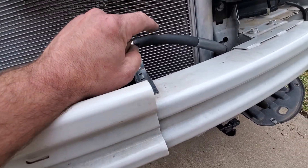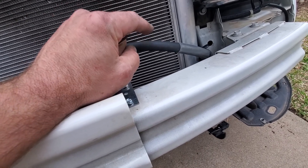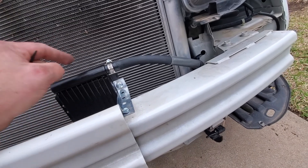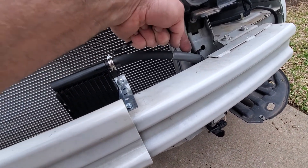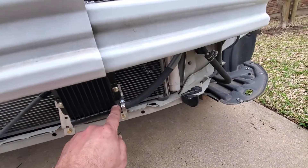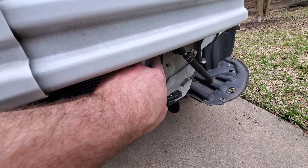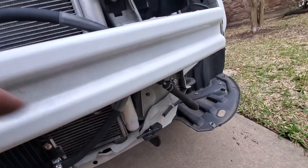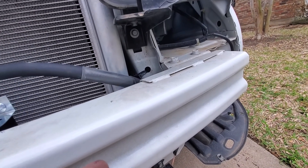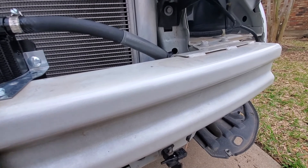This line is coming from the return of the radiator. So it supplies the radiator loop, comes out of the radiator loop. This is coming out of the radiator loop, coming into the top of the cooler here, and then coming out of the bottom of the cooler here, going to the return, which is the filter side. You'll see a canister filter in there.